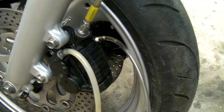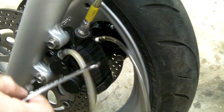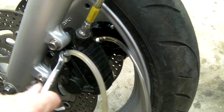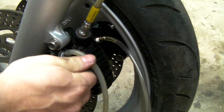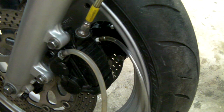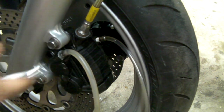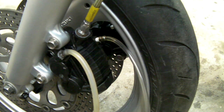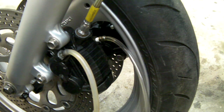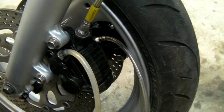I think that's probably your lot for now. I've got a decent lever that would stop the bike, but once it's warm the moisture in the air in the lines makes it worse and before you know it you've got crap brakes barreling into a corner faster than you want. But yeah, we've successfully bled everything up, it all works okay, I'm happy. Cheers guys, see you next time.